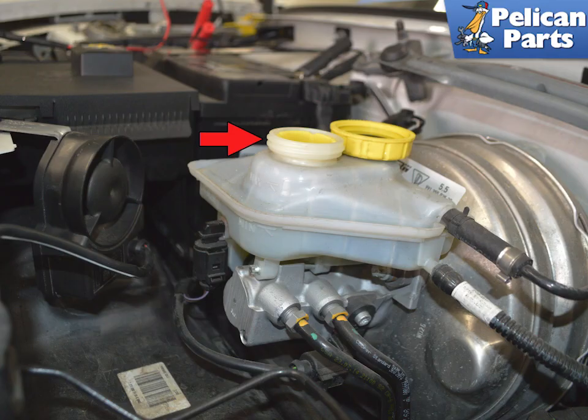You are going to be pushing the pistons back into the calipers. This will cause the brake fluid in the system to move back up into the reservoir. Open the front trunk and remove the access panel for the brake fluid reservoir. Make sure there is room in the fluid reservoir for the fluid you are pushing back in. If the pads are really worn and the fluid level is between the max and minimum line on the reservoir, you may need to suction a little out.